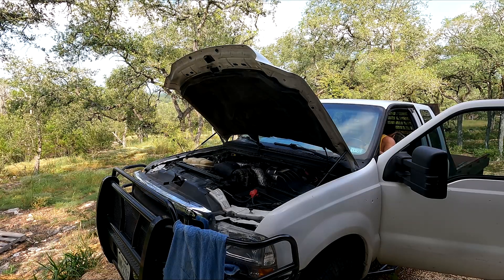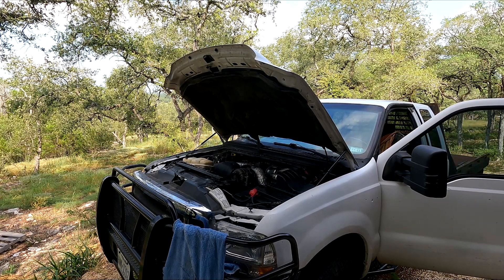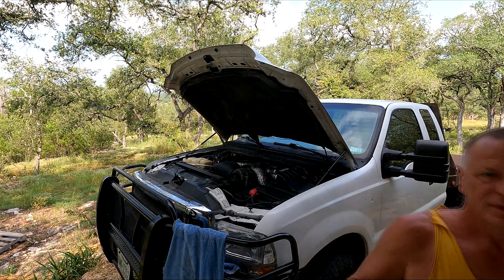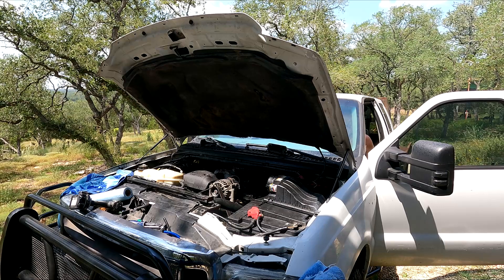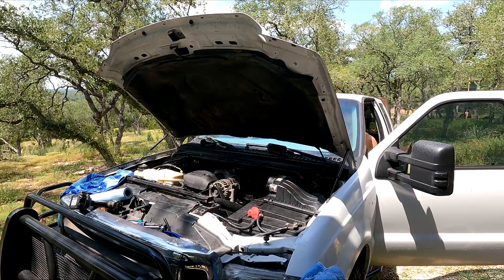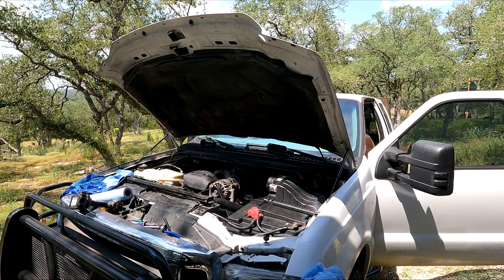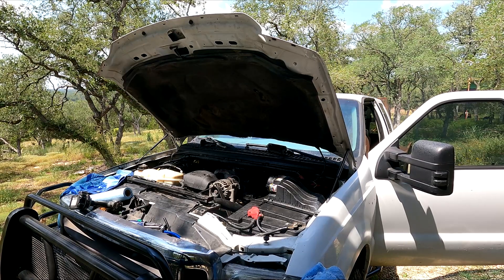Attempt number one — started it up and the motor is oil hydrolocked. I wasn't happy when that happened. I kind of had a feeling it might because there was oil that drained down into the cylinders — a lot of YouTube channels tell you to clear that out. What I had to do was spin the motor by hand on the starter after removing the glow plugs first, to get the oil out of the cylinders. There was quite a bit of oil to push out.